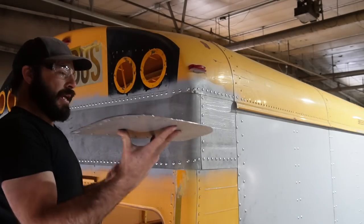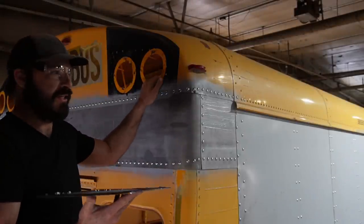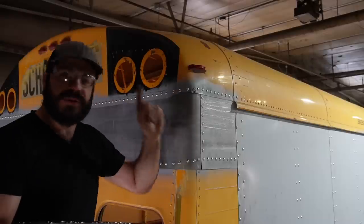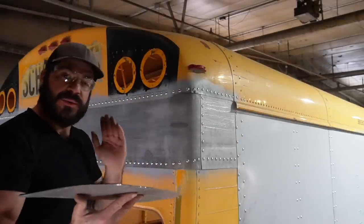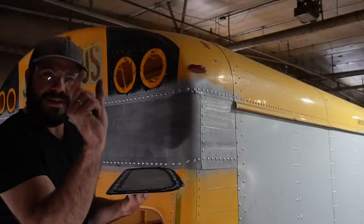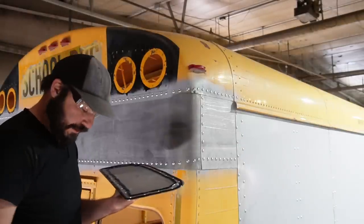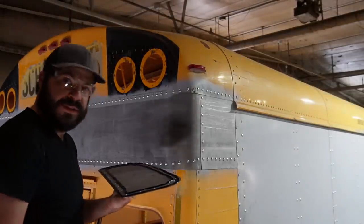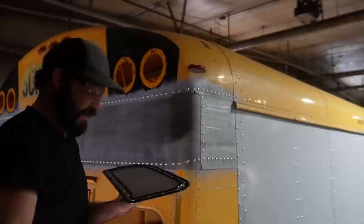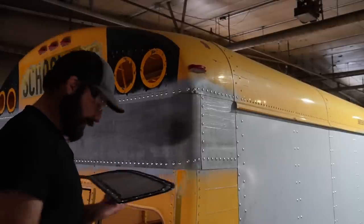Delicious. Now you really can use whatever fastener you would feel most comfortable with on a project like this. If that is self-tapping screws, no problem. If you want to use nuts and bolts, go for it. But around here, we really like rivets, and we like them for a few reasons, but my favorite reason is that they pinch super tight and they can't ever vibrate loose. Awesome fastener. So I'll be riveting this on with quarter inch structural pop rivets. Totally overkill? Yes. Is it what we have? Yes.